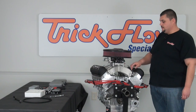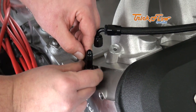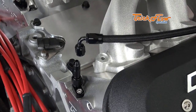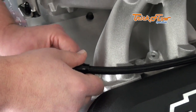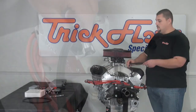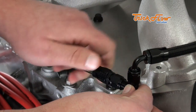Now that we've spun the engine around, this is the line that we attach to the passenger side front. You're going to install your swivel T to the passenger side rear, and make sure that the straight part of the fitting faces the driver's side rear fitting. Then you'll install your line from the front to attach it to the rear. Next you're going to want to install your 90-degree hose end onto the driver's side rear fitting, and then to make the connection to the swivel T, you'll use your Dash 4 straight fitting.